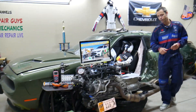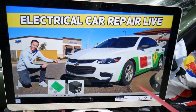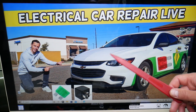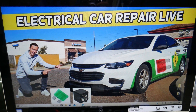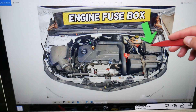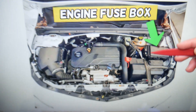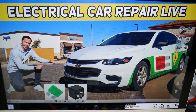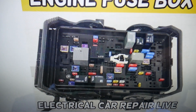If the radiator fan does not turn off, there is one fuse that you need to check first. We're going to explain where it's located and demonstrate on a 2017 Chevy Malibu. You have three different fuse boxes — we'll be working in one of them today. Open the hood, face the engine, and on the right side — the driver's side — under that cover you have a fuse box. Open the cover and you see a fuse box layout like this one here.